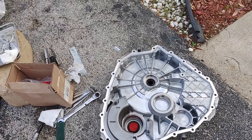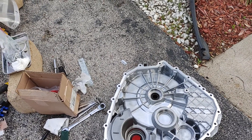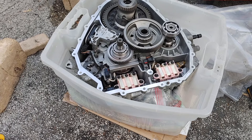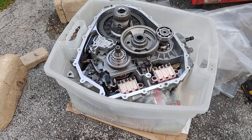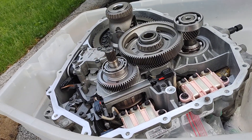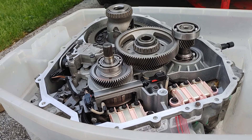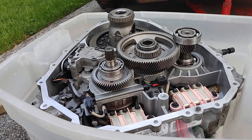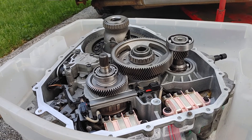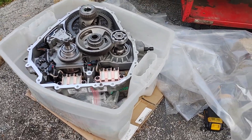I'm going to walk you through how I took this apart in a moment, but first I want to give you some background information on the transmission. The transmission part number is DG9Z7000EC, and it is a 2.57 final drive ratio transmission. There is another gentleman who runs a school and does EV transmission and engine breakdowns — he tells you pretty much everything you want to know. Kudos to him, because I would not have gotten to this point without his YouTube University video.